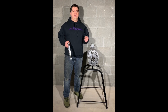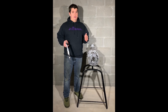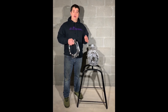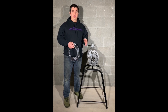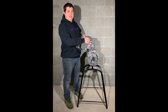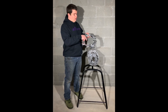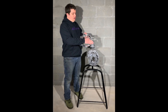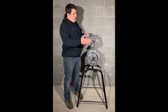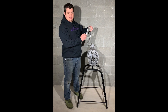But we want to take it to the next level. We wanted to make it so that you — the drag racing guy specifically — who wants SFI approved bell housings can do this without modifying it and wrecking that SFI certification. So to do this, we added two 5/16ths grooves through the adapter plate. This allows the bleed and feed line to run across the plate under the surface where the bell housing mates up, and when you put the bell housing on top, it provides very clean access for the bleed and feed to exit the adapter plate.